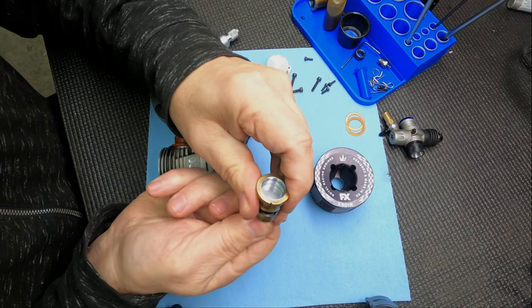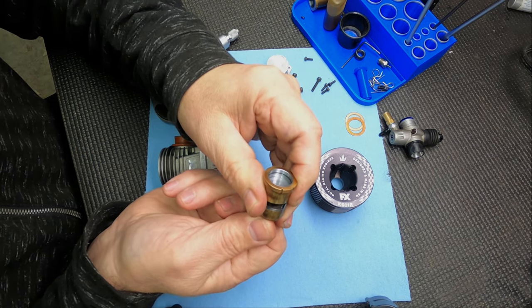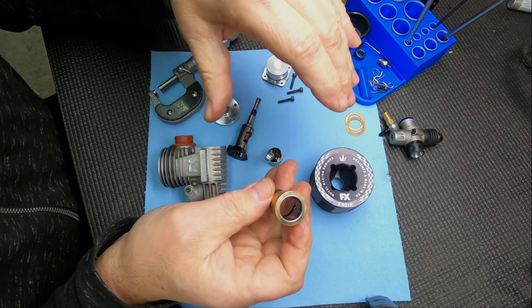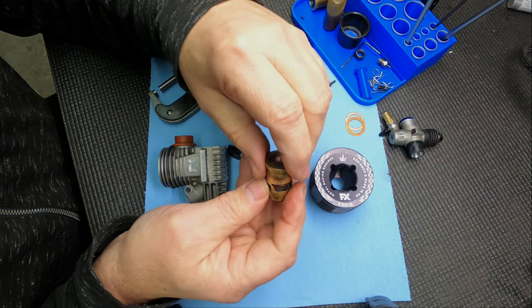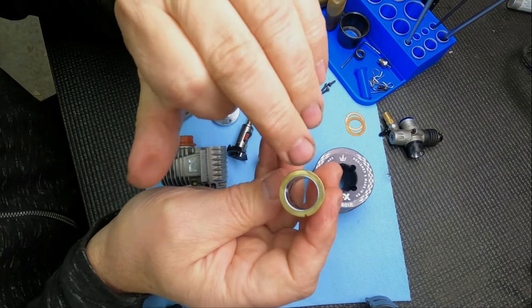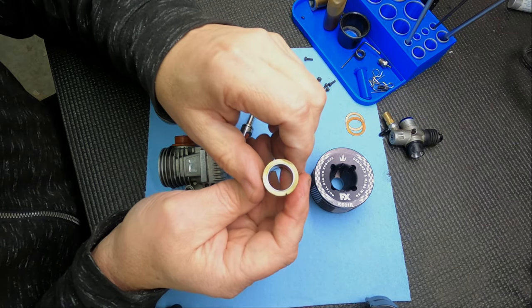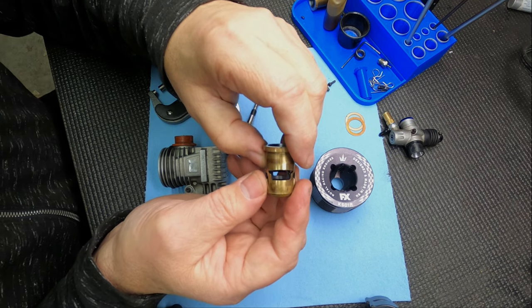I push up to about where it stops. I don't like to over-pinch them so they have to be broken in too much - I just resize them about like an engine is after a gallon. I resurfaced the top of the sleeve too. If you're comfortable rebuilding your engine yourself, you can just send me the piston and sleeve for $15. I resize the sleeve and I also stone the top with a machinist stone. There's a little bit of a spot on this side that didn't quite clean up, and that's pretty normal. Heat cycling is important on break-in.